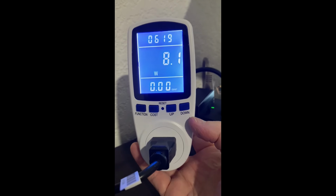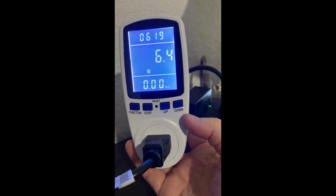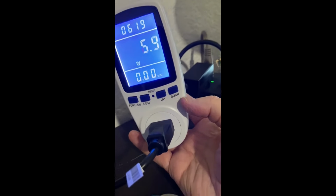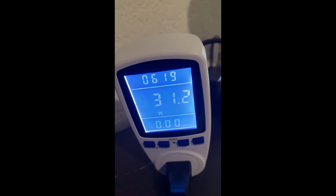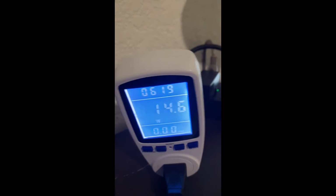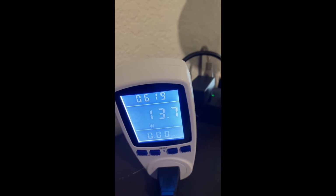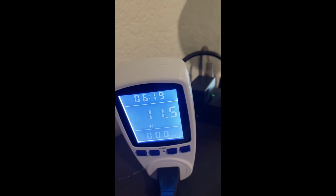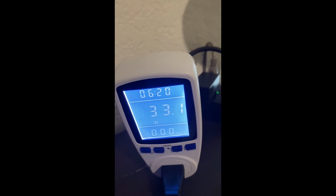And it's booted. So it settles back to about 6.5, almost 7 watts, but that's super low compared to 450, 750, 1,000 watts. All right, I've logged it in so you can see again it peaks up. It's hit around 50 watts there, just trying to get all the systems and things started that it uses. And then again, it settles back down.